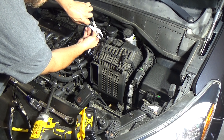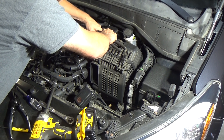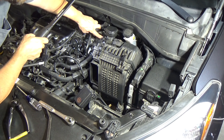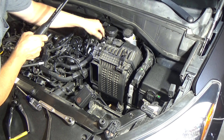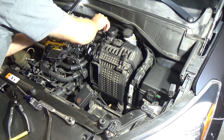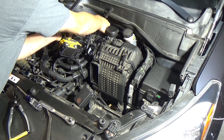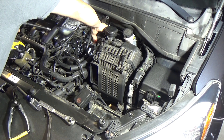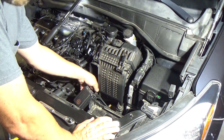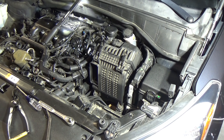Let's disconnect this hose right here. There's a clamp for the intake throttle body tube from the air filter box — we need to loosen that clamp so we can get it out of our way. Sometimes if they've been there a long time, the intake tube can kind of get stuck on there. I almost forgot to mention — we've got two 10 millimeters down here we need to take out. Let's get a swivel on the 10 millimeter so I can get in there a little easier.